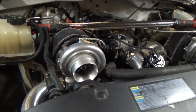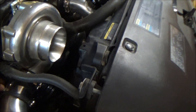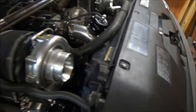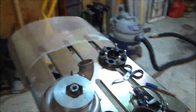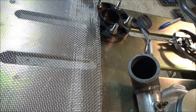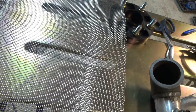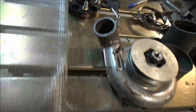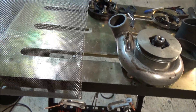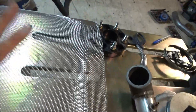It used to be you had to pick one or the other. So I told him, what I'm going to do is order the parts to build my own and show people how to build them. So that's what I'm doing. I was able to get this screen here — looks like it's enough to make a bunch. I actually went with a pretty decently gauged gap so it shouldn't cut back the airflow too much. You don't want to go much smaller than this. I know it doesn't trap a lot, but this is a 5/64ths stainless, one foot by three foot. Got it from the Summit website. Maybe $12 to $20, something like that — but there's enough to make a bunch.